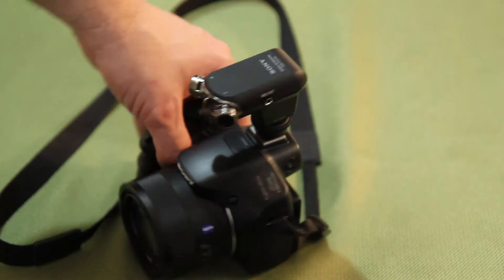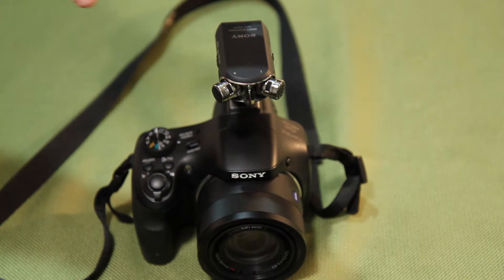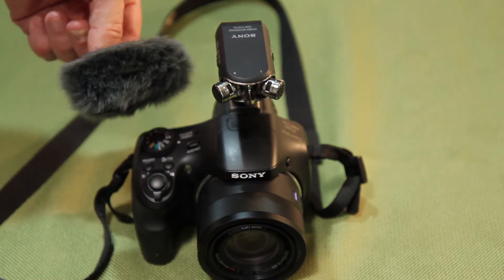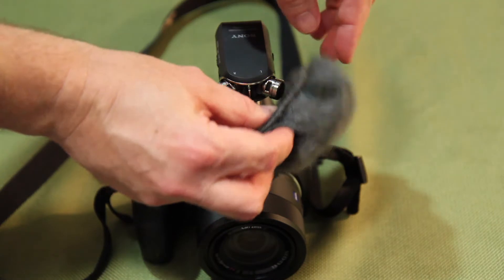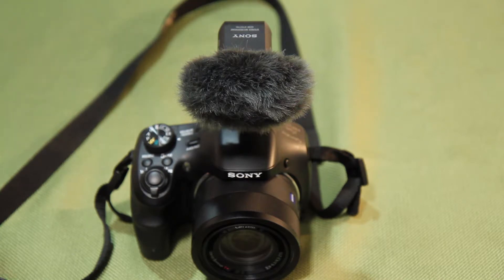This also allows you to use the microphone with a non-Sony camera or an incompatible Sony camera by running a cable from the line-out jack into the camera's input jack. One important thing to mention: when you attach it to the camera, it becomes extremely sensitive to wind noise — basically not useful as-is. You have to use the included windscreen, which some people call a dead cat. You just pop it on, and that takes care of most wind noise. Enabling the low-cut filter helps a little too.